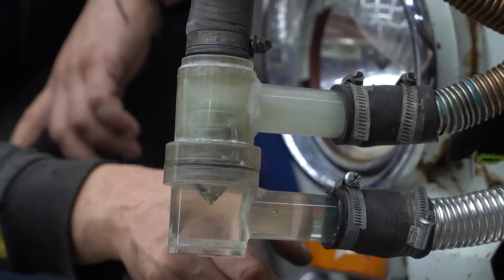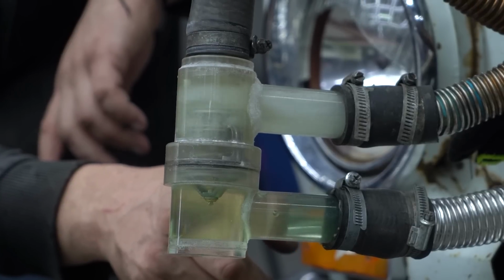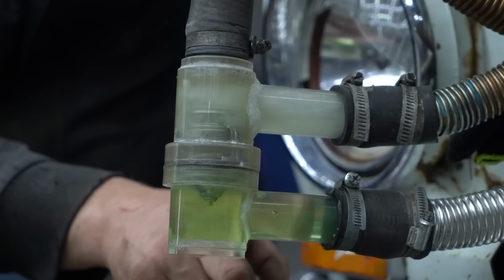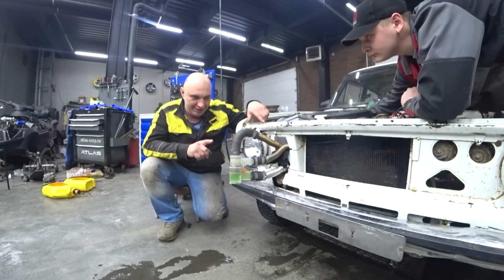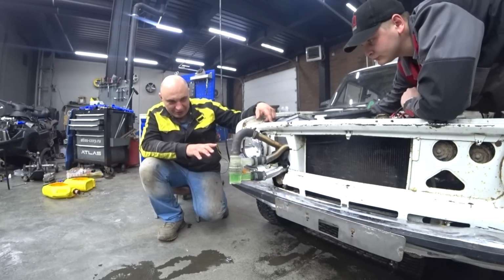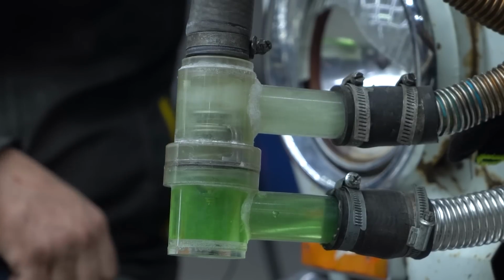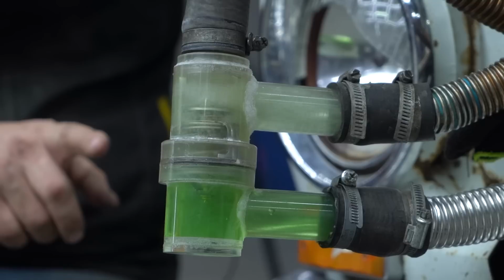Yep, something is definitely happening. The thermostat is now open, and the water is going around the large circle, through the radiator. There's the colored water. It isn't particularly intense, though. It's flowing slowly, slowly but surely. Still going, and the thermostat is staying open. Seems to be going well. I take it, it's only starting to open. So apparently, it's not being fed in portions. The valve is open and we have continuous flow of liquid.